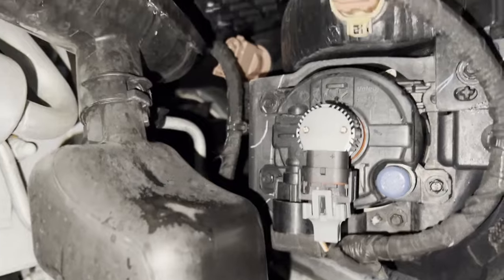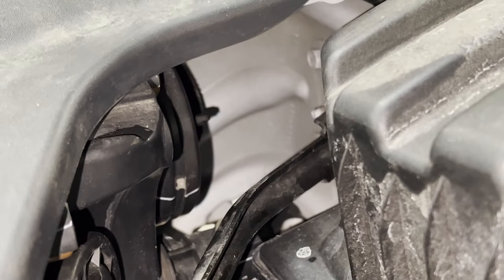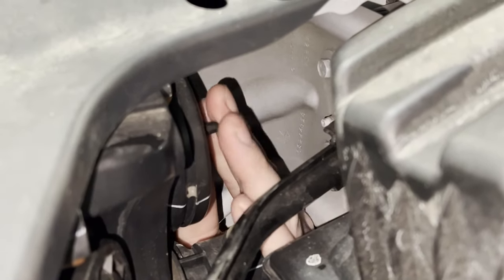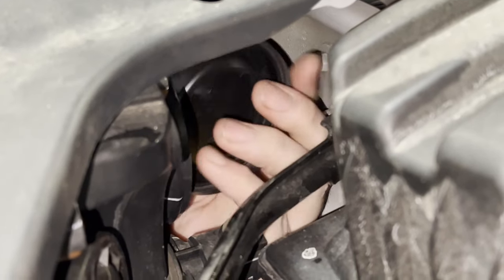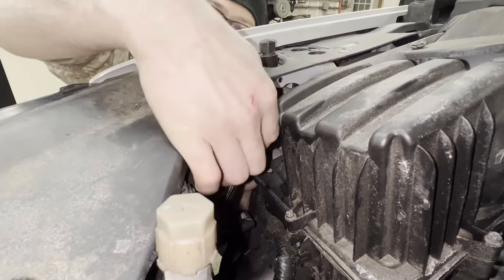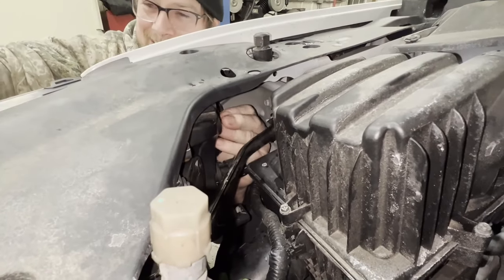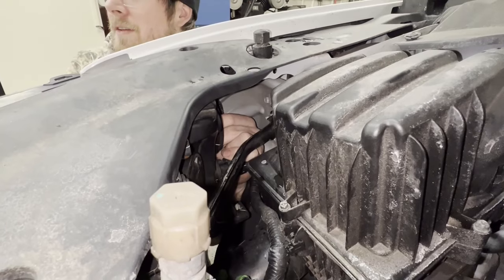This gives you pretty good access — you can see the entire headlight assembly and the fog light assembly. We can see the fog light assembly and, moving up, right next to the wiring harness there is the dust cap for the low beam. Here's a shot of the same dust cap from the top side — I'm just reaching up from the bottom through the wheel well. Rotate the dust cap counterclockwise to remove it; they can be stiff so you may need a fair amount of strength.